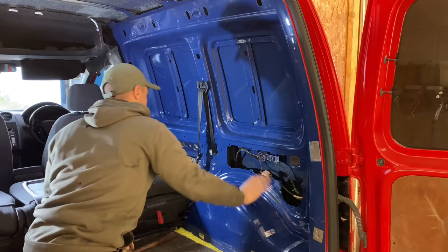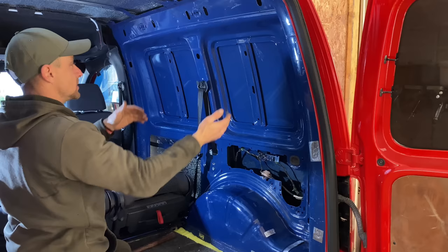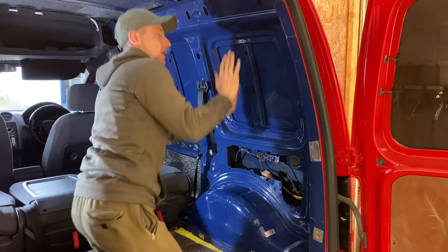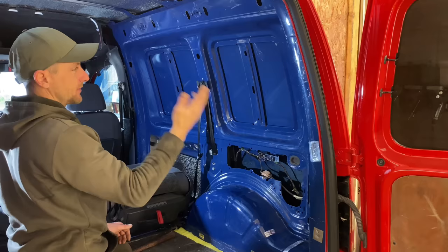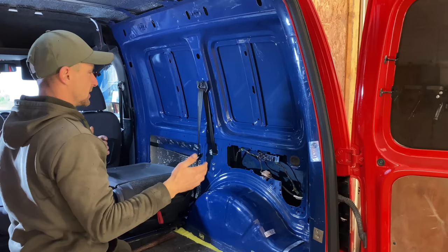The second method is to board it completely: go off the top of the wheel arch all the way to the roof, cutting the panel all the way down and all the way around — basically just a box. It's all right, but in a small van you're losing a lot of space. From the panel to where the wood board would sit is about 120 mil of wasted space. You're probably never going to need that extra 120 mil, but it's more aesthetically pleasing to make the most of the inside.